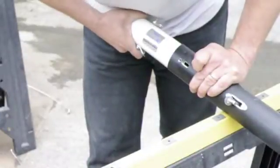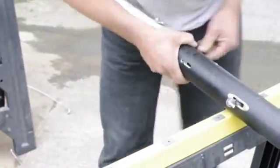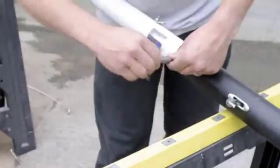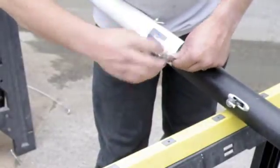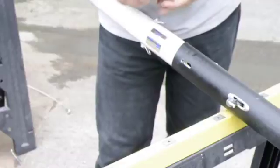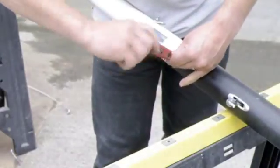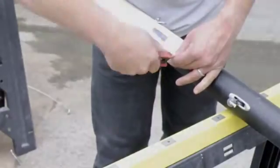Sometimes, rather than just going in with the Allen bolt, the way to get it to line up is to quickly run through with your 5mm tap, which helps it all to align itself, and then wind your 5mm bolt through, trying to keep the thread nice and straight and square to the mast, so as not to cross thread it.